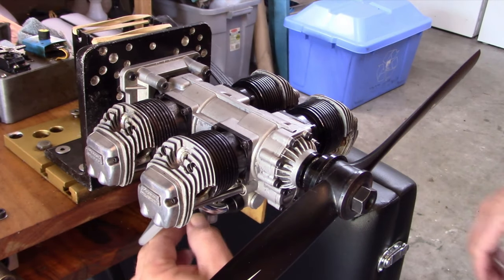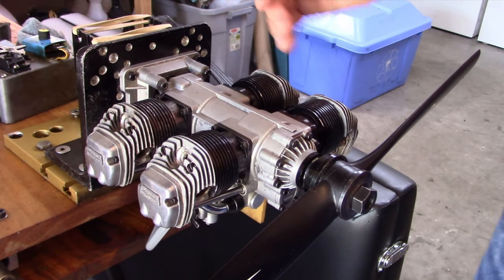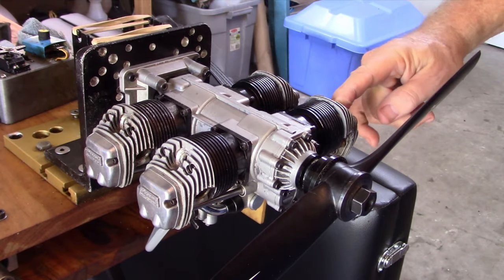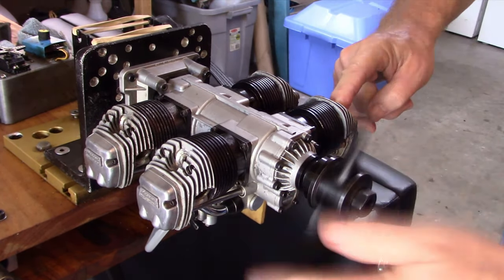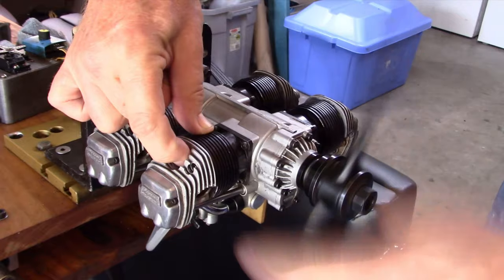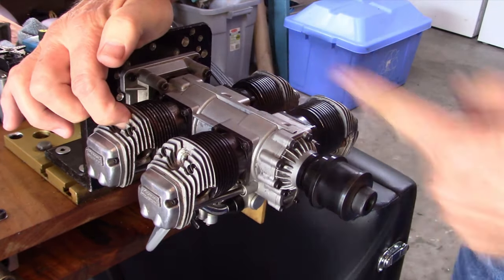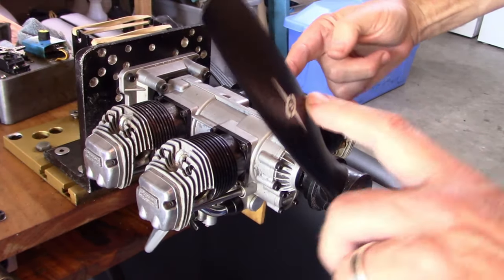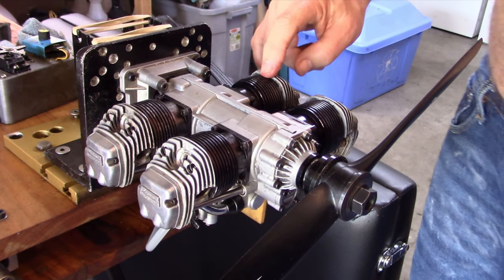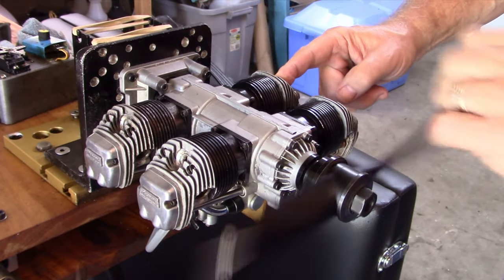Let's see if our carb is still free from the other night — it's still pretty sticky. What I'm going to do now is stick my finger over each glow plug hole and see if I get compression on any of the cylinders. In the first video I said I thought I felt compression on one of these. So this number 2 cylinder actually has compression and valve train movement. I can make it whistle with my finger there.